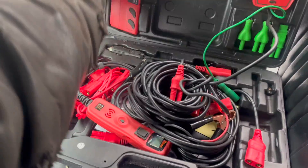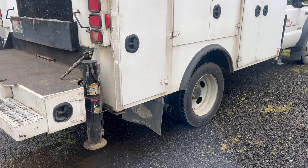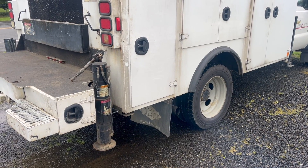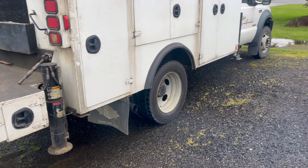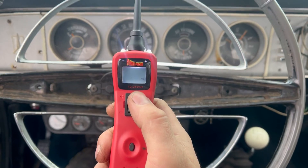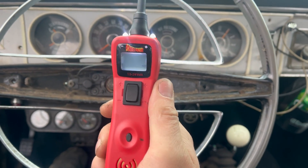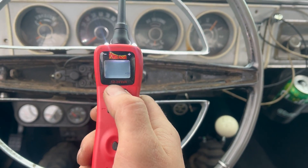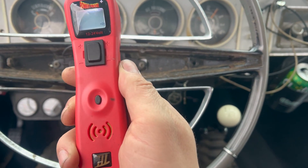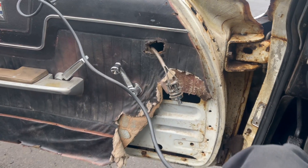To do this, I've got my old friend the Power Probe — well, this one's not actually mine. And this kit is way too nice. Apparently these guys have a service truck, which — yeah, jealous — but it obviously runs perfect and makes smells, so that's delightful. I still can't believe he has a nice battery hold down. Now I've spent a lot of time on the channel extolling the virtues of the Power Probe. If you're gonna do much electrical work, you need one of these things. They can output 12 volts, a ground, and actually the fancier ones can do lower, like sensor-level voltages too, which is cool. And it's so fancy — by fancy I mean super basic, but it never worked before.